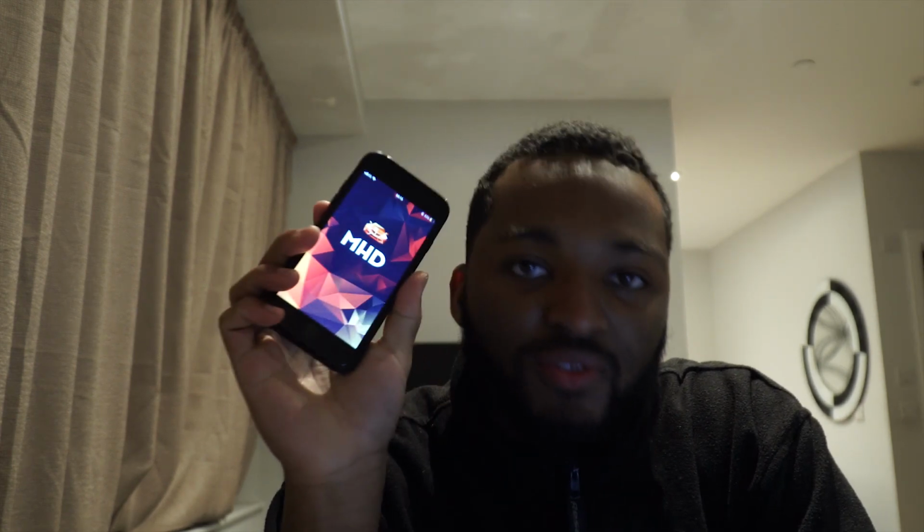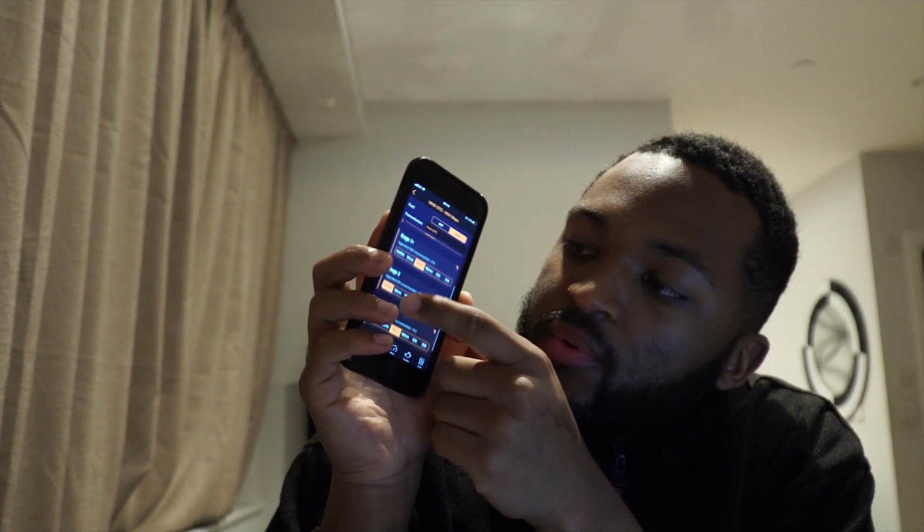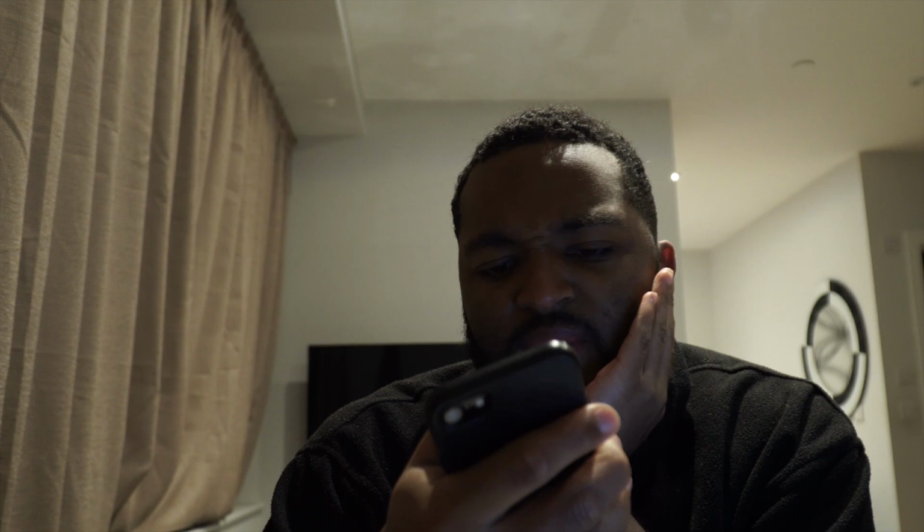Welcome to the end of the video, guys. I actually flashed MHD Stage 2 Plus. He filmed it once before me flashing Stage 1, so I didn't think I was gonna do it again. I literally just did flash and map V9, and then I bought the Stage 2 Plus, and I'm running on 98 RON, which in the US is 93 octane. I'm interested to get the 102 octane map going, so when I pick up some octane booster next, I might do some runs in that.